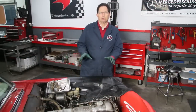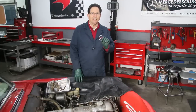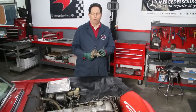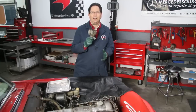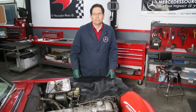When it comes to working on these older mechanical fuel injection systems, there's one thing I go after right after I deal with a thermostat, and that's the distributor. You're looking at these old point-style distributors, and if you've been around these, you know the problems. You have failed condensers, you have corroded points, pitted points, and everything gradually deteriorates. When it does, you start losing the quality of voltage to the spark plugs.